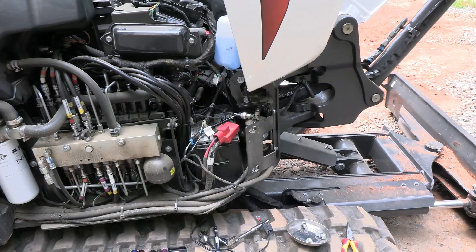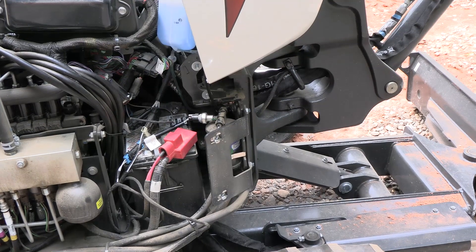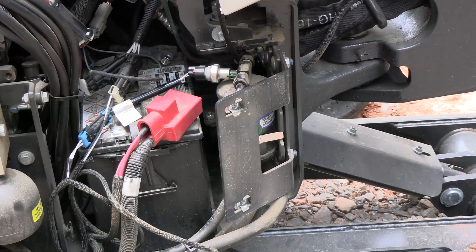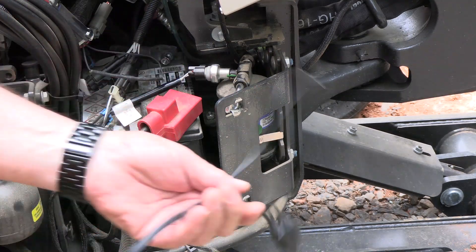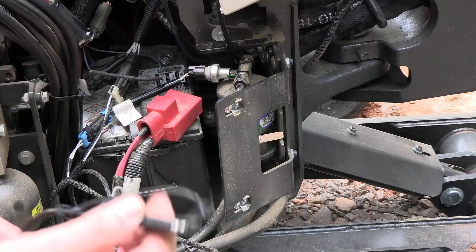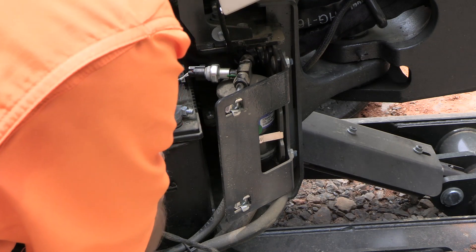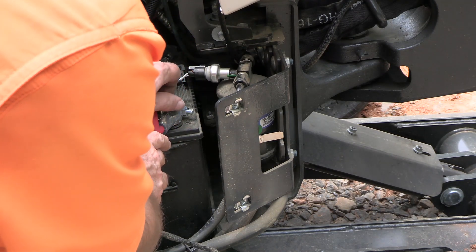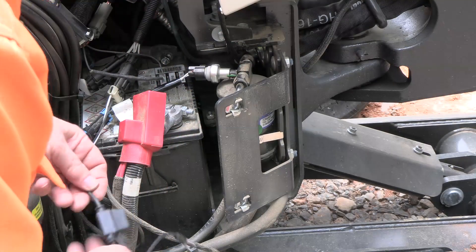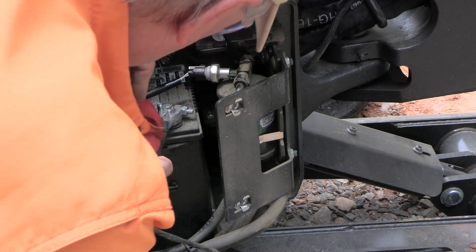We've found the battery. Zoom in a little bit — each of the terminals has a great place to connect a battery tender cable. We need obviously the positive and the negative, and this is the connection to connect to our cable. Here under the positive there's a nut — take that off — and we'll feed the positive cable up there.